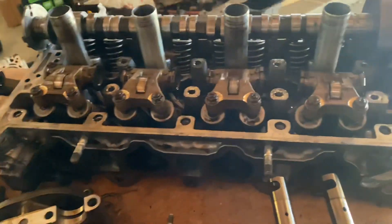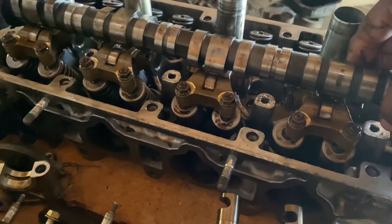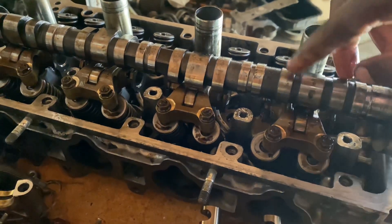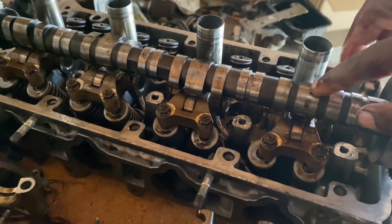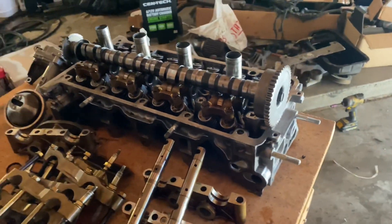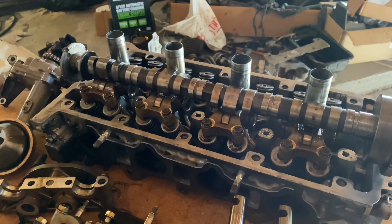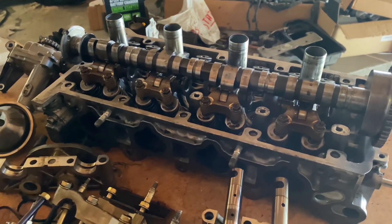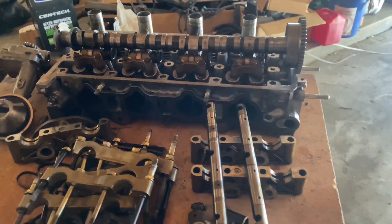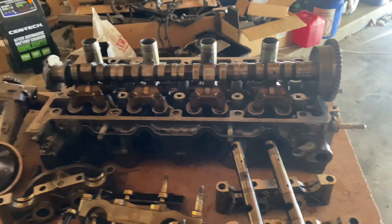This is basically what they do on race cars — they delete the pins and just use the one lobe cam. On race cams they might not even come with the outer lobes; they just come with the center lobes that are huge. It's possible to do this setup with stock parts, no problem. You just need the other side rockers, which you can find on any A3, A4, A8, or A1 head. I've seen them push about 195 horsepower with the VTEC killer, on an EP3, maybe a little more on the K24.